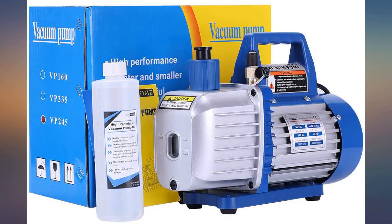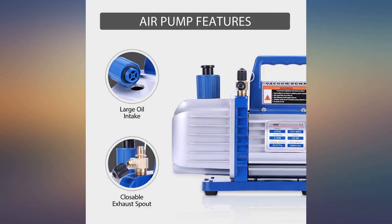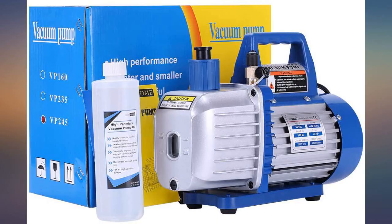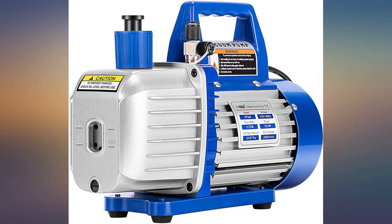This will do a home and auto AC system. I used this to pull down a vacuum on my newly redone AC job on my Pathfinder, and it pulled down within about 5 minutes. Let it sit for 1 hour to see if there were any leaks in the system — was good to go. Then I let the pump run for 2 hours before recharging the system.